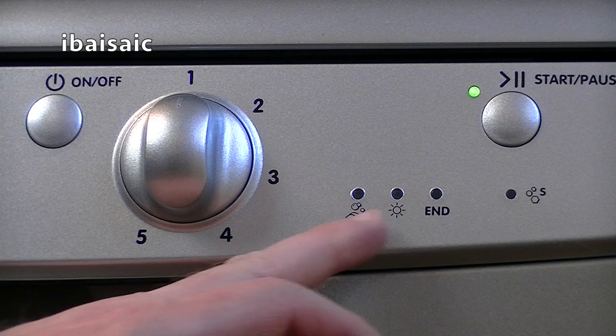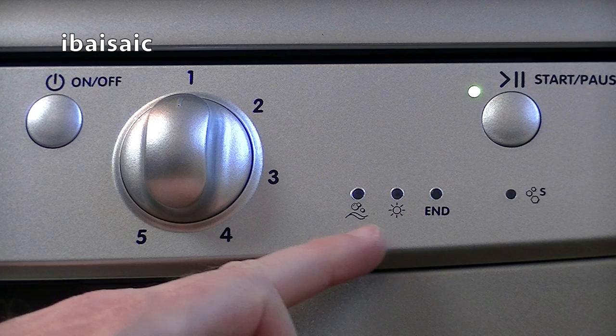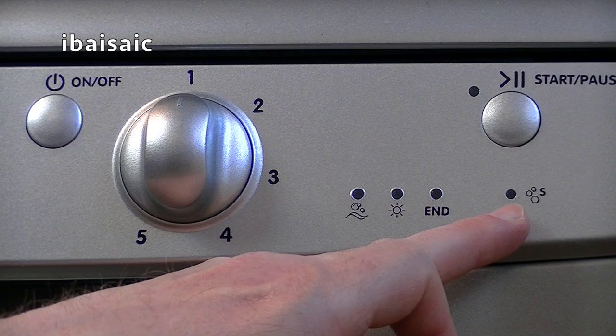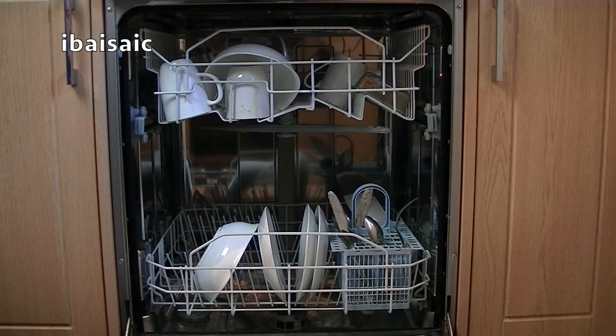This is the program state indicator. When this little light is illuminated, it means it's in the wash phase — and I'm assuming it's also in the rinse, so washing or rinsing will light up. This little sunshine figure must mean it's the drying phase, and then you've got a light to show you it's at the end. There's also an indicator to tell you when you need to put more salt in the machine. If you don't use combination tablets and you live in a hard water area, you will need to put salt in this dishwasher.